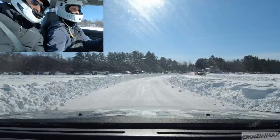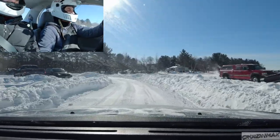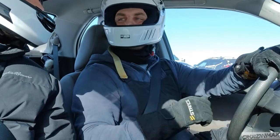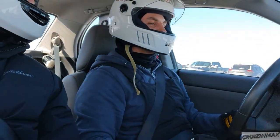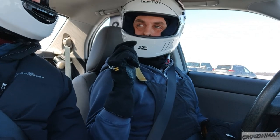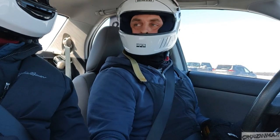3:56. Hey, with that three-point turn, it wasn't bad. But I dropped too much pressure from the front. That's why it's so loose. It's not grippy. You dropped too much. We're supposed to have less pressure in the rear. I do. Okay. It was better on your run, and you were like 26 pounds. I dropped it to 21.